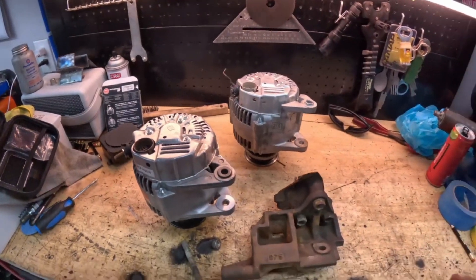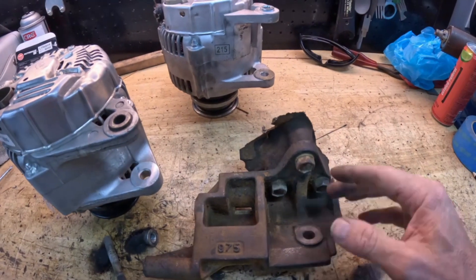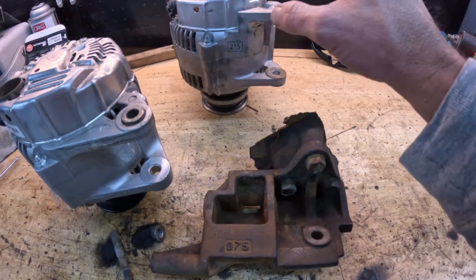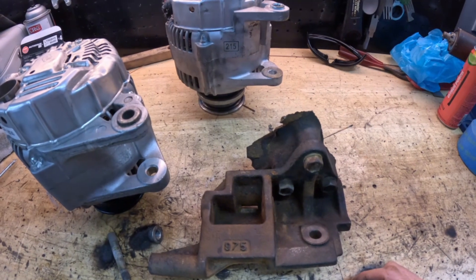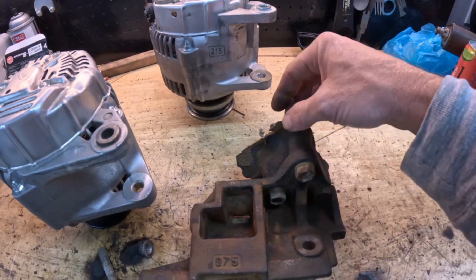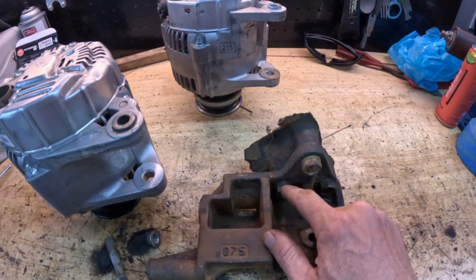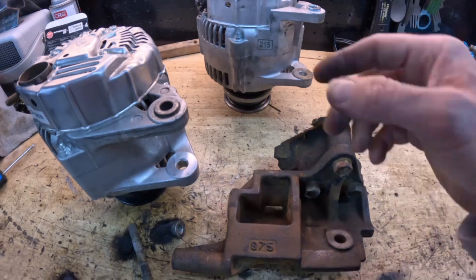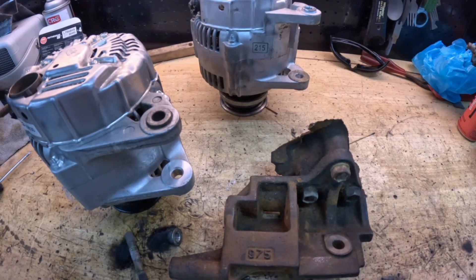There's another school of thought which is to modify the bracket itself. I have thought about that, but this isn't my truck — it's a customer's truck. If you ever want to go back to the other style alternator, you may have messed up the bracket. So it's easier to modify the actual alternator itself than to take the bracket off, and taking this bracket off is a little bit of a pain. As you can see, there's the one I ordered from eBay. These two bolts are actually pretty easy to get off but they're very tight — it's this one right here that I felt like I was going to snap in my customer's truck. That's why I got on eBay and ordered this one. It's going to be a little bit of trial and error — we're going to grind, do a test fit, grind, do a test fit until it comes out right.